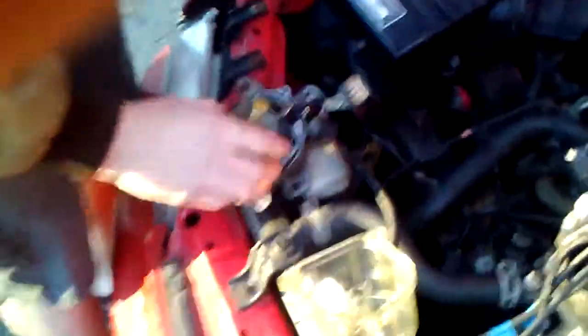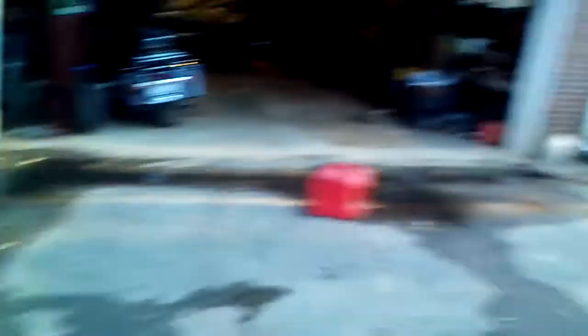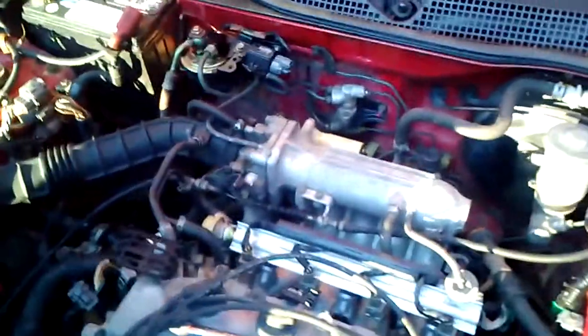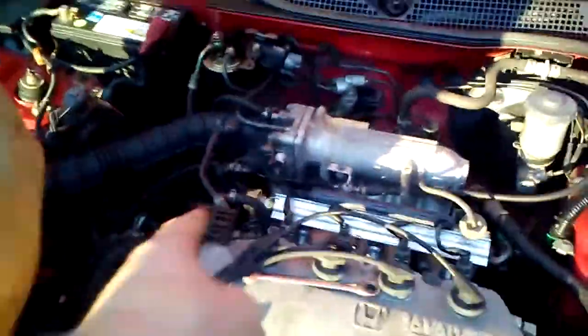Battery's charged a little bit. He's gonna break the cap trying to get it off. Took the can and topped it off with a little bit of fresh gas, enough to hopefully start. We did a little bit of prep work earlier - checked to make sure it was getting fuel and the fuel pump is working, it primes. Loosened the valve, a little check valve, and gas came out - it smelled old like varnish, but hopefully it'll be okay. This should fix all our problems between the main relay and that distributor.